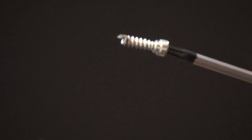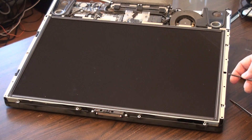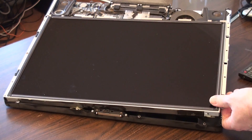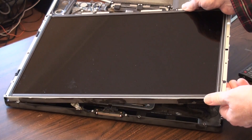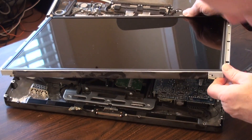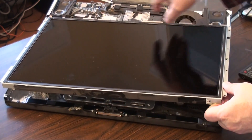We'll make another further-away spot for all the screws that actually hold the LCD panel itself on. The torx screws that hold on the LCD are different than everything else — they look a little different. We got all the screws out. Now let's just use a little screwdriver to get our fingers underneath there, and the LCD comes up. You've got to look because there are definitely cables underneath there.